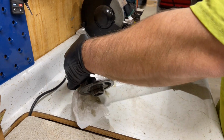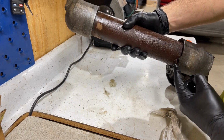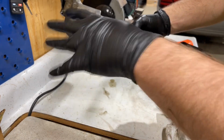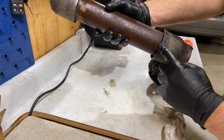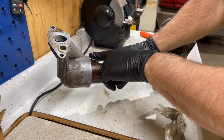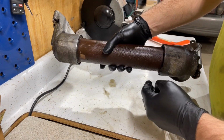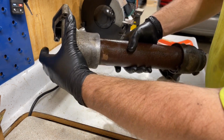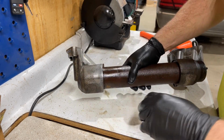So these oil coolers, I've cleaned this one up a little bit. It still has some oil in it. So you have a pin and a pin. Those pins don't matter, which way this oil cooler goes does not matter. However, you have an alignment area here, and there's no alignment area on this side here. So when you put these together, you want to make sure that you're still able to spin this very, very lightly, and you'll use lubricant to put these O-rings back in.